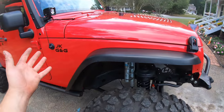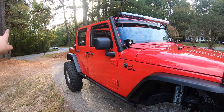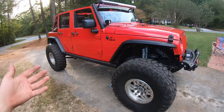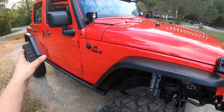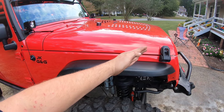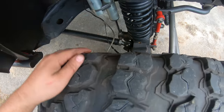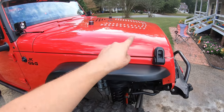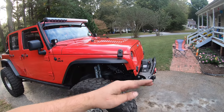For DIY alignment — like any lift or suspension modifications — it's always nice to take it to an alignment shop, but with custom stuff like this most shops won't touch it. You have to find a mom-and-pop shop or align it yourself. The biggest thing that'll change is axle placement forward and aft, as well as side-to-side canting. The easiest way to measure is from your body mount to your ball joint or knuckle — take that measurement on both sides and compare them. If the axle has shifted, shorten or lengthen that link until it's centered, then use the upper link to adjust your pinion angle and caster.